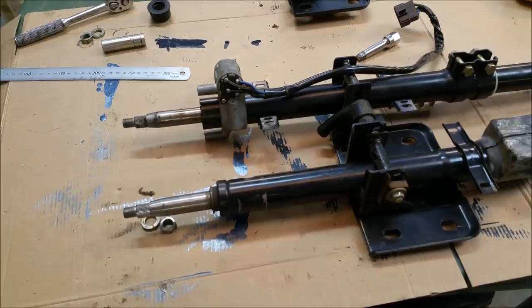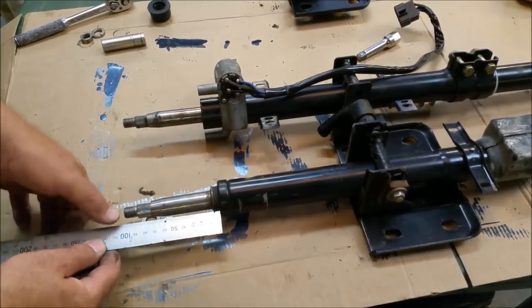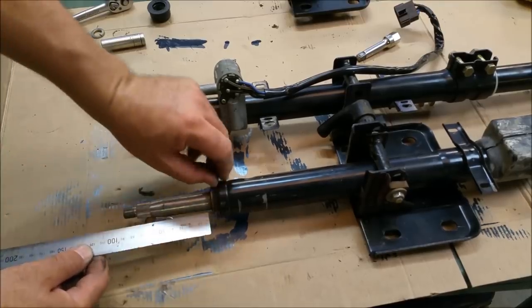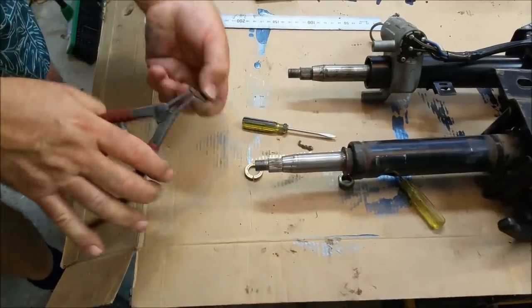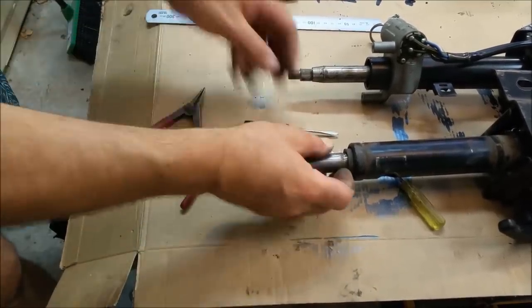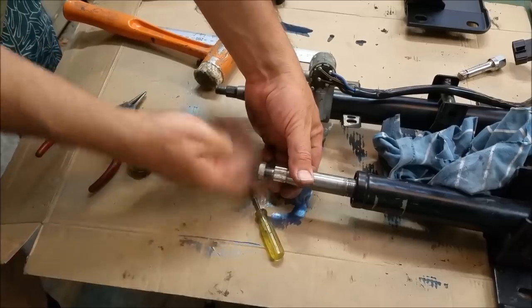I'm going to take this column out and have a look. At this end we're probably 95, maybe 96mm, and from down here we're probably 103mm. Even a couple of mil out at this end is going to mean the steering shroud will drag on the back of the wheel. So I'm going to take that off - the thrust washer will come off, then there's a collar, and that little guy should come out from the other side. I'll put the nut on the end so it's flush, just use a soft hammer.